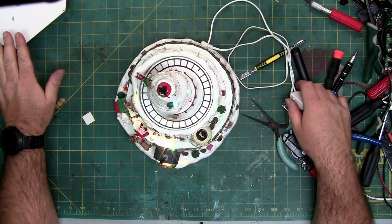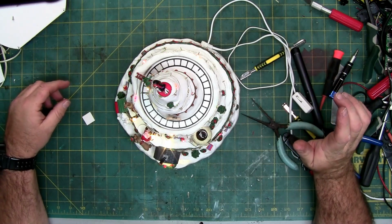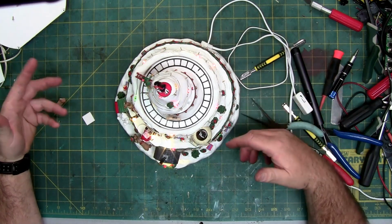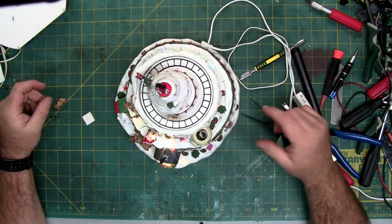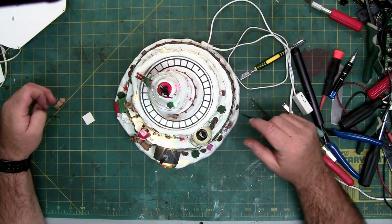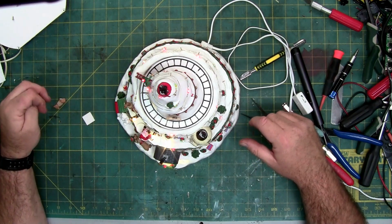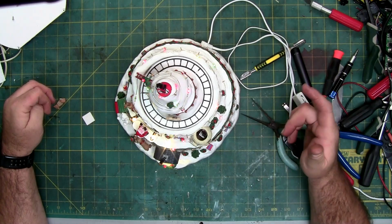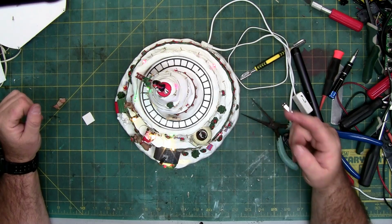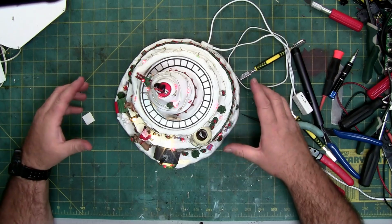Don't worry about the screws to hold the plate in. As far as taking this thing apart, basically just peel your mat off. Either you do it destructively like I did, or try and be polite and do it slowly and carefully and so on. Leave the four screws in, unless you want a way to put your fingers inside to help hold it for realignment. Once you do that, heat up and or peel out, or however your glue comes out, get rid of the hot glue, and then carefully try and drop it straight down.